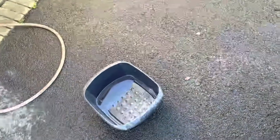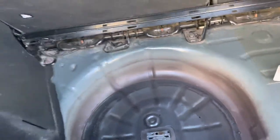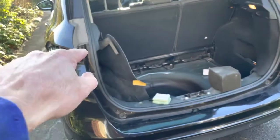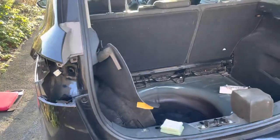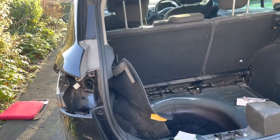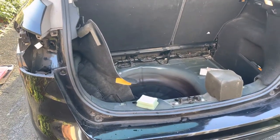I've already sponged out a load of water — that's the second lot — but you can see it's still wet inside and there's a good inch of water sitting in there. What also happens is this build-up of water causes high humidity within the car, which plays havoc with the light section and affects the fuse box and cabling that runs underneath the seat, which then affects the rear sensors and the radio.